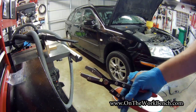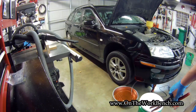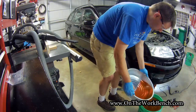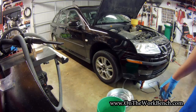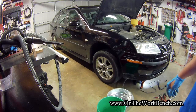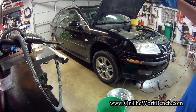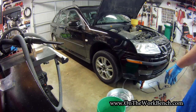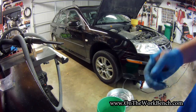Once you've got most of it out, use your hose clamp pliers to close off the hose, then drain the waste coolant into a bucket clearly marked 'waste coolant' for proper recycling and disposal. I needed a second bucket — this is actually the second vehicle I'm working on this evening. Now I'm going to close the petcock underneath, add the coolant flush and more distilled water on top, start the car, and run the heater on high to circulate everything through the heater core.